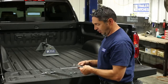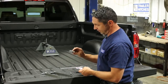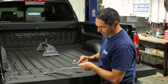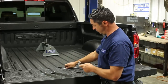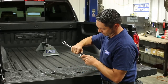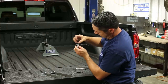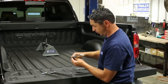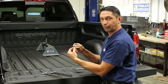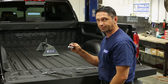Before putting the side plates in, take the time to set up the bolt guides. These little guides come welded together in pairs — just break those apart. Take your three-quarter-inch hardware with the 15/16 head and start the bolt into the strap with the head on the side with the little hold tabs. Thread it through until the bolt is up against those tabs, using a hand wrench rather than a power tool so you don't bend the tabs down. It's very important for those tabs to engage the corners of the bolt head — this keeps the bolt from spinning when you put it in the frame, since you have no way to get a wrench up in there.